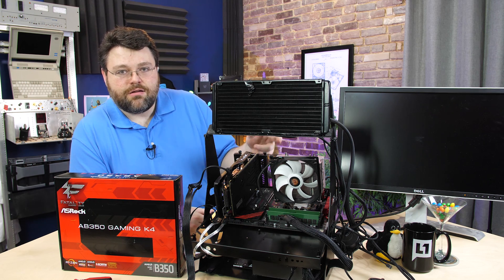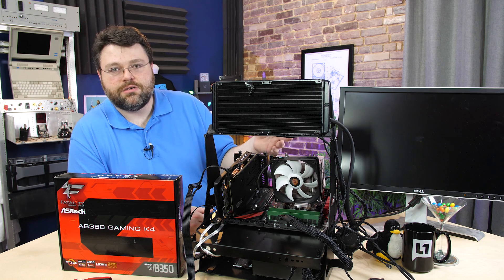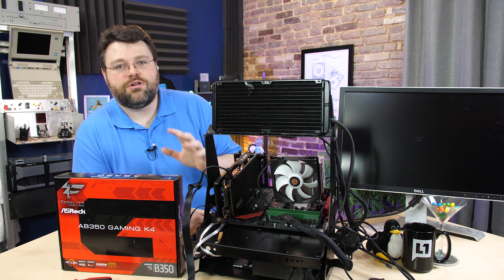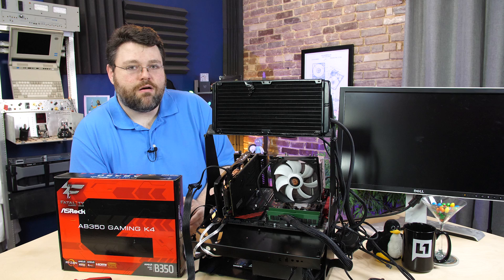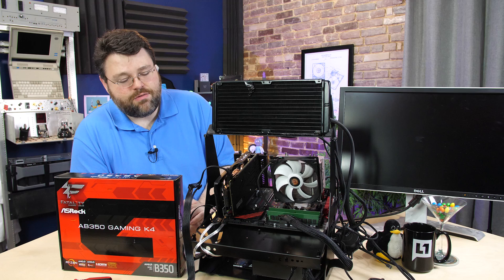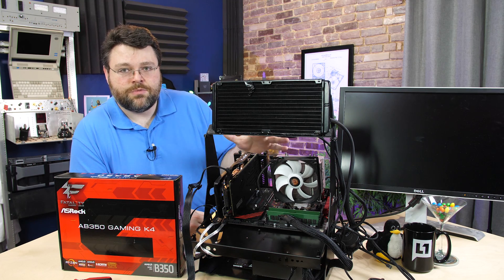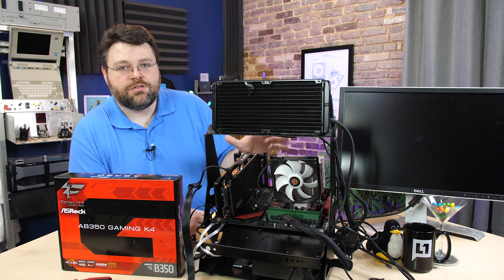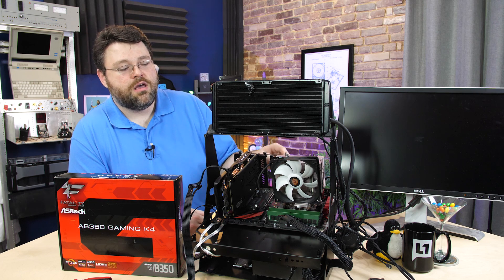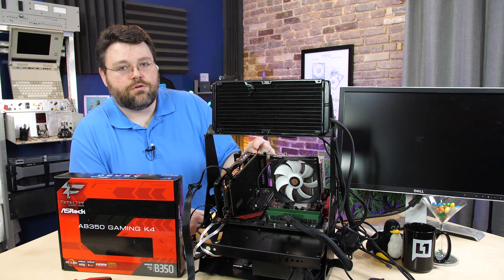If you're going to mix Radeon cards — like an older Radeon card and an RX 460, 470, 480, or 500 series — you can totally do that and it's fine. And because there is true hardware isolation, you should not run into any problems as long as your RX series graphics cards support being re-initialized. We're going to have to build a list, and that list is probably going to be in the Level One Tech forums. If you pick up this motherboard for IOMMU and you've got a graphics card combination that works, definitely come post in the forums — because you can do it without the ACS patch on this motherboard, since that PCI Express x4 interface normally shared with NVMe is in Group 0.